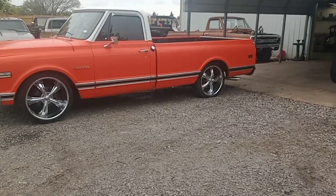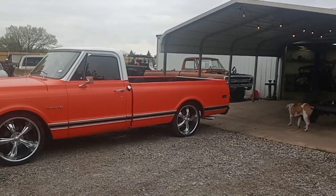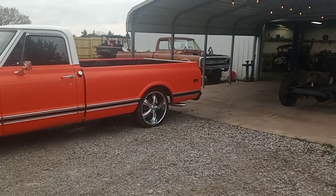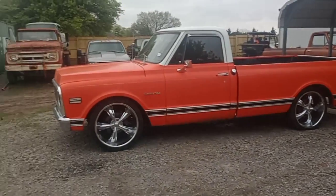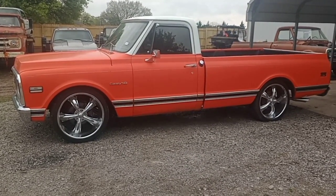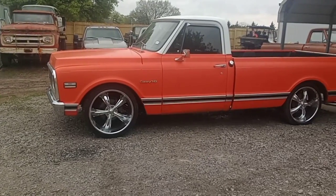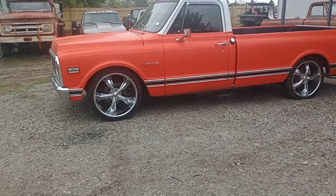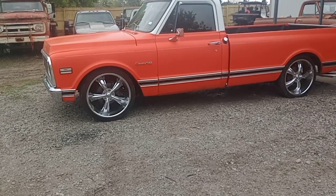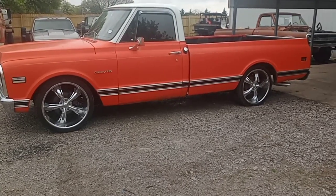So what I'm going to do first is remove this bed and the back bumper, which you guys know. You got to take out the bed bolts, pretty simple, and the back bumper. And then I'll be removing the front bumper, 4 body bolts underneath, and 2 front core support bolts. And then I'm going to drain the antifreeze. And if you guys got any transmission lines, you got to remove those. They're going to leak. This is a standard truck, pretty basic. Take the gear shifter out.